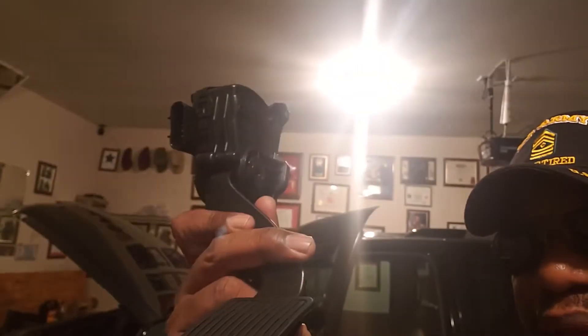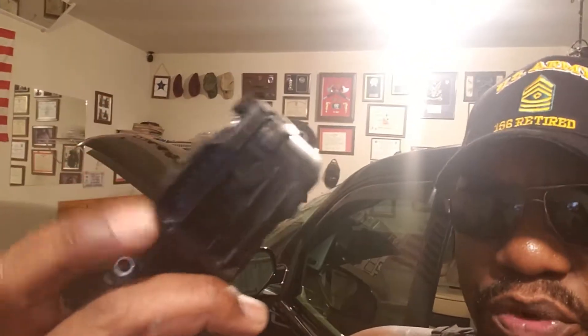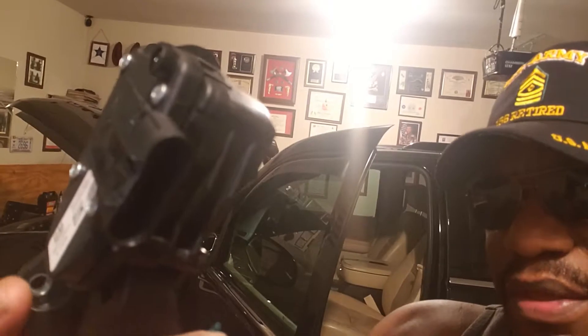Old-timers called it a gas pedal. Today's electronic technology is something totally different. It has a mount here and a mount here, and it has a plug-in right here. You undo those two screws — here and up top — they are 10 millimeter screws. Once you unscrew those, plug the mount, plug the plug back in, and it's replaced.